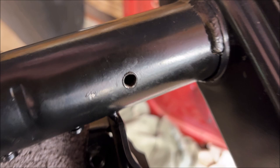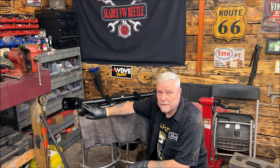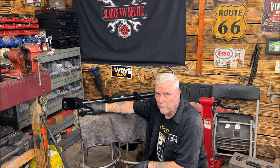So I looked online quickly, and they use this strange thread size, like 5/16 or something on these. Why would you do that? It came from CIP1. I'm going to tap them at 8 by 1.25, and I'm going to grab some new grease fittings, but we can go ahead and do what we're doing today, and I can come back and do that. So the parts we get today are much different.